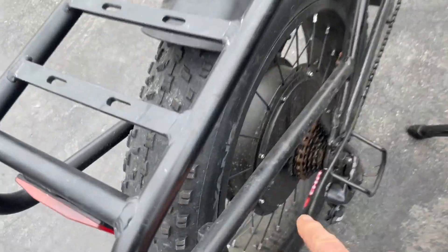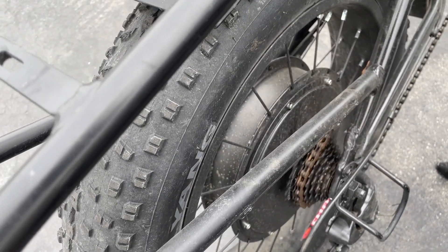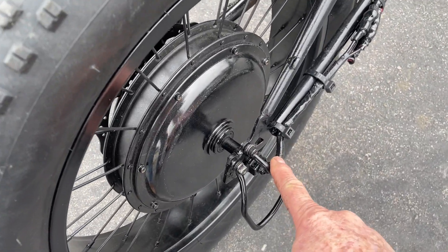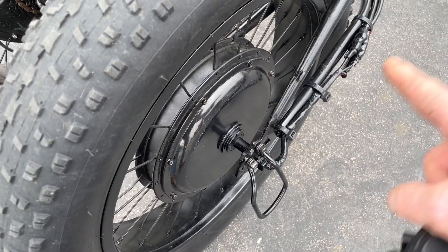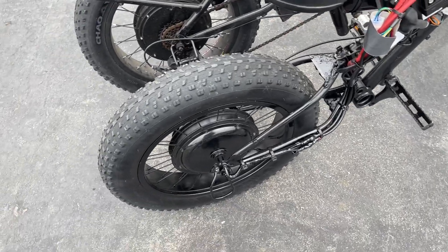On this one, the wires don't even get warm. But this guy here — the wires were getting hot, actually fairly hot. Of course I ran those 14-gauge wires right to the coils and it doesn't seem to get warm at all, hardly. So it does pretty good. The motor — I can feel it after I've been riding it for about 10 minutes. It's lukewarm but not hot by any means. On a hot summer day going up a long hill you might have a problem, but you just have to be wise about that and not overheat it.